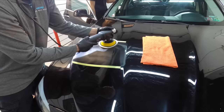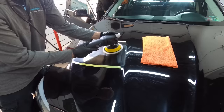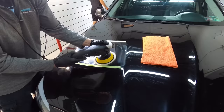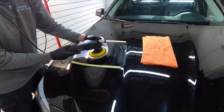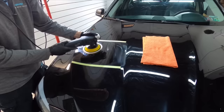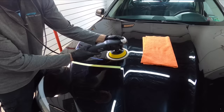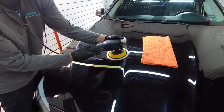Always pick out a little spot, mostly in an inconspicuous area, but for the video purposes I have to do it up here on the hood where we can mask a little area off and test the combination of pad, polisher, and correction fluid to see if it matches the imperfections and the clear coat we're working on. I have the rotary set between the third and fourth speed setting. Pressure is always equivalent to a firm handshake for me — kind of light, only using my thumb as pressure down on top of the polisher — and we're doing a crisscross pattern keeping the polisher as flat as possible.